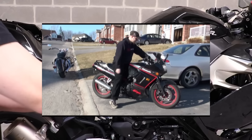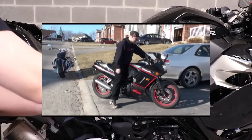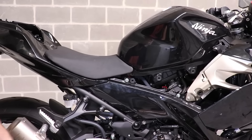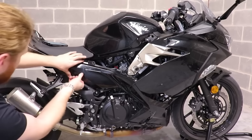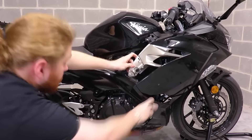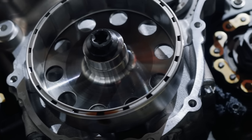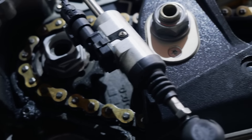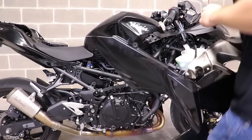The first-gen Ninja — the 1988 to 2007 model years — is fairly bulletproof. It's a simple engine made even simpler with carburetors. The main complaints are that it takes a long time to reach operating temperature, the oil light comes on during heavy braking, and the gas tank whines after a ride. The biggest issue is a knock that comes from the clutch basket — normally nothing is wrong since the Ninja 250 is a loud motorcycle, but sometimes the plastic bumpers in the clutch wear out, causing an unsettling amount of noise. Another obvious problem is the carbs, which will need constant maintenance to keep running well. There doesn't appear to be a fatal flaw with these bikes, which is why you see so many sky-high mileage Ninja 250s.